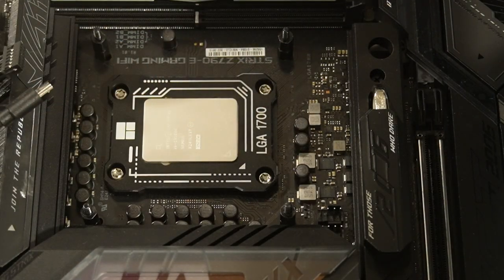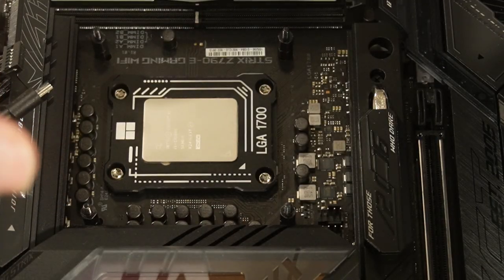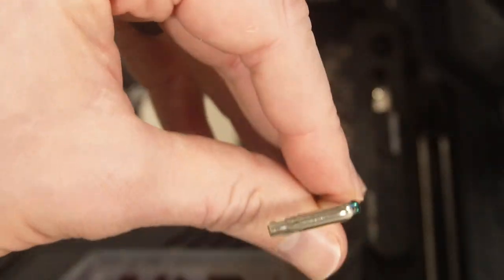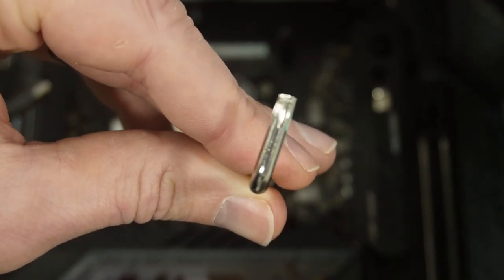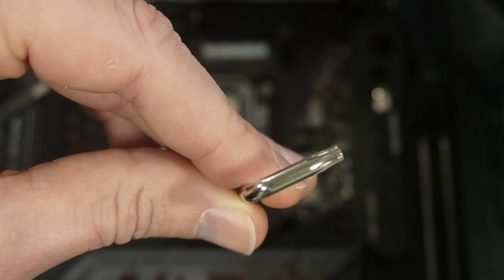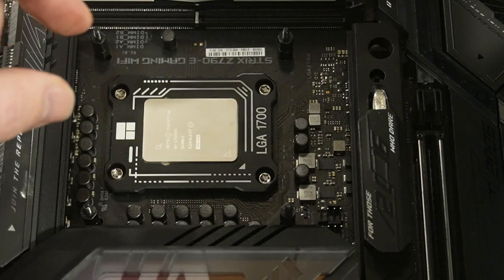What I'm going to do now, so I hit that hard wall. There's two walls, right? There's a little resistance. Once you hit a little resistance, we go from quarter turns to eighth of a turn. So 90 degrees to 45 degree turns, right? Once you start feeling that pressure, you go to 45s. So you've got the 90 degrees and you've got the 45. It's not rocket science. Do the best you can. And then once you hit that hard wall, you stop.